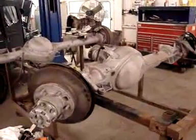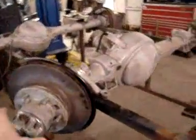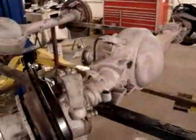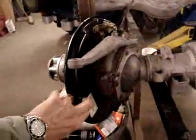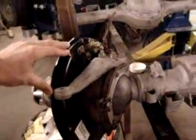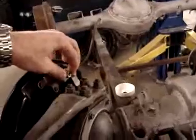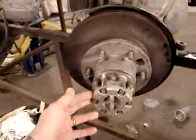These are the front axle and the rear axle to this project. What we've done is gone in and rebuilt this front axle, which is pretty important to do. What you're seeing here are brand new backing plates. The backing plates that were there were pretty well hammered, and we just put brand new backing plates on this. The backing plates allow for the brake line fittings to be put on there. And we went in and did a full axle rebuild.